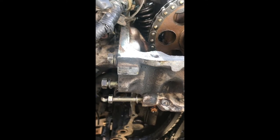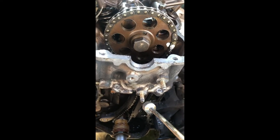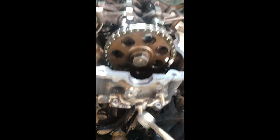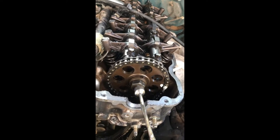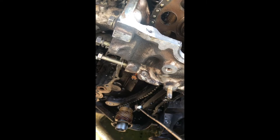Everything looks good. I'm gonna get a new tensioner — actually I'm gonna go ahead and change everything. I already opened this engine last year, and the previous owner seemed like he was taking care of it. But since I opened everything, I'm just gonna put a new kit and get this thing going. So if you hear noise, the car won't start, it seems like it's spinning, and when you turn the crankshaft bolt you don't see the distributor or timing turning — that's probably because the chain came off or the sprocket is broken, as in my case.